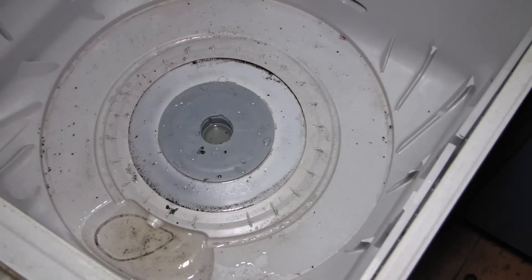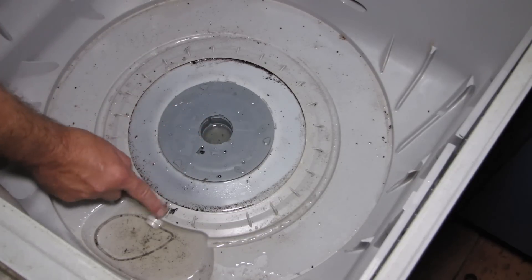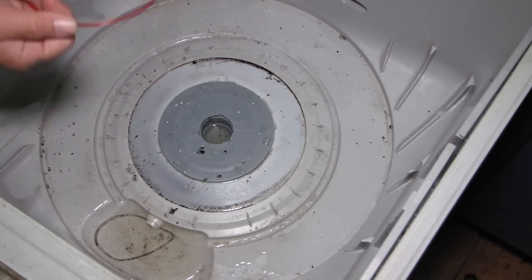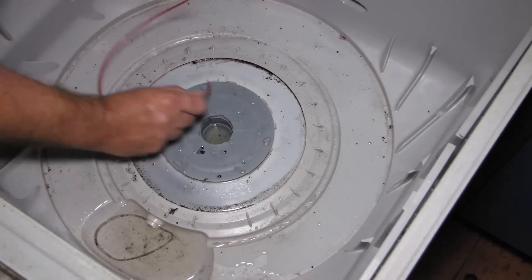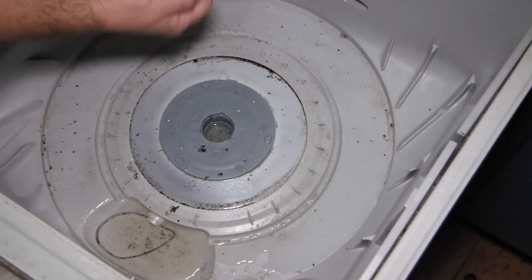I bought the new part because I read online that if it's not draining properly, that's what you should do — but it didn't fix it. The tech said it was worn and showed some metal filings. What I also read about was a channel that runs from in here through to a hole — this is actually the pump. You need to make sure that channel is clear. I grabbed some whipper snipper cord, and the hole is just to the side of a little piece of plastic on the bottom.